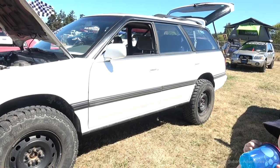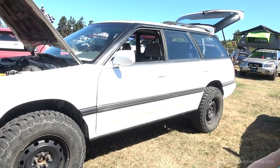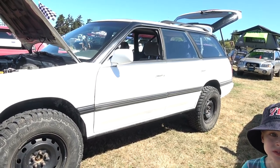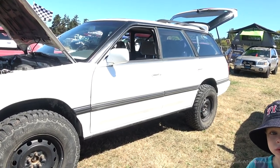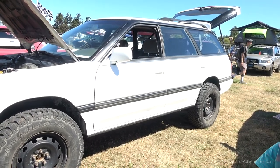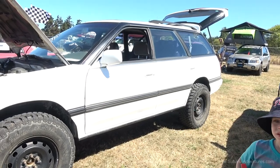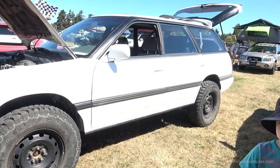So it all depends on how old the transmission is. Did it get crap stuck in the back of it at some point, which is clogging something up, or is your clutch still good? Even with the new, rebuilt 4EAT I just put in, every once in a while it'll hop when I come around corners. If I yank it really hard in a real tight corner, it'll bind up and then loosen. I just think it's because it's rebuilt and still working things through, but I'm not too horribly worried about it.